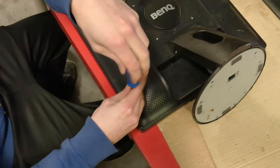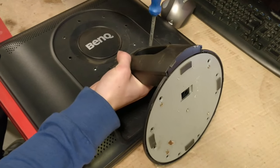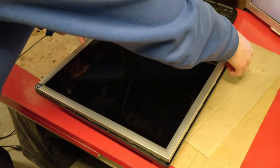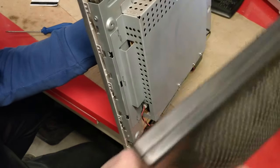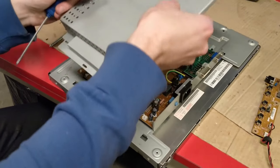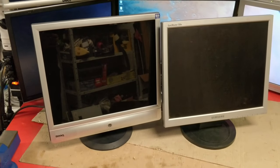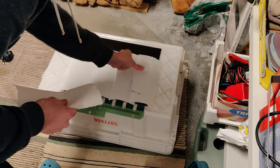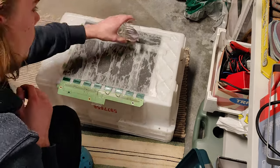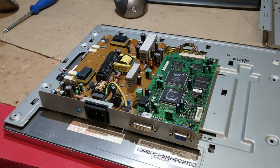First let's disassemble the monitor. This time we're going to use a glossy panel. You can either use one that's already glossy, or you can remove the anti-glare film by soaking the panel with wet paper towels for something like 4 to 6 hours. Don't use too much water or keep the panel wet for more than 6 hours or you might damage it — we killed one this way. After that you should be able to pry the film off fairly easily. So here's the monitor's logic board.